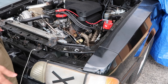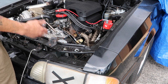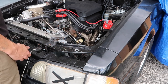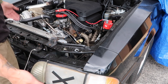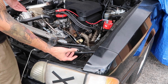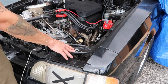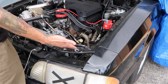The first thing you want to do is locate the area where you're going to install the actual pins into the radiator support, then get the pins installed. Since we were previously running hood pins, I know exactly where they go. On the fox body platform, right here in the front there is a hood adjuster — it has a little screw and a bump stop so you can adjust the height of the front of the hood. There's one on both sides. That's where I chose to run the hood pins — I just removed the hood adjuster and that's the hole we're going to use.